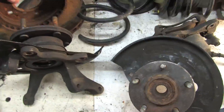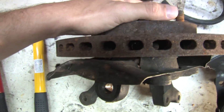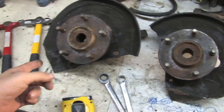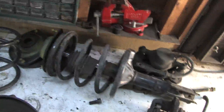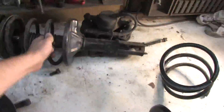Nothing a hammer can't fix. I'm using the 92 all-wheel drive Turbo Eclipse brake calipers and rotors because they're vented discs for better cooling, and because they're actually a perfect fit on these Expo knuckles with the 5-lug Eclipse hubs pressed in. The rest of the Eclipse suspension stuff is pretty much useless — there are several things I don't like about its geometry and some of it's dangerous, but we'll get to that shortly.